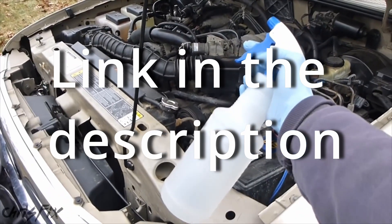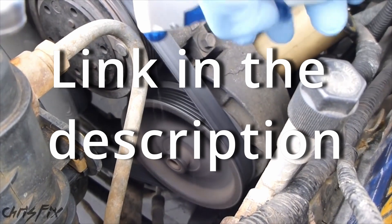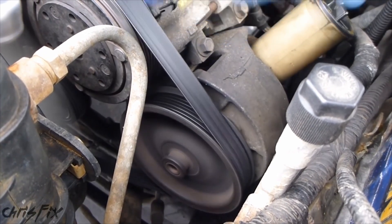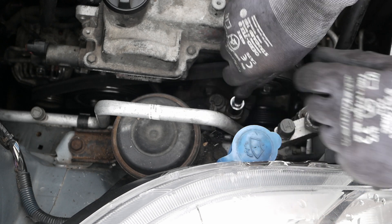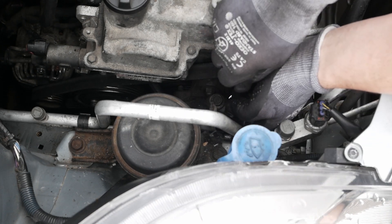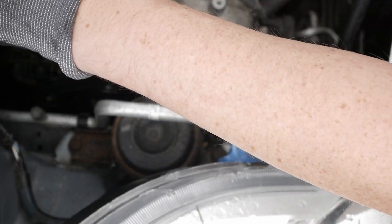His video said to spray water on the belt, and it stopped squeaking — it's probably time for a new belt, caused by misalignment and worn-down belt teeth. I thought I'd replace the idler pulley first because it's a quicker and easier job, and only a couple more quid. That other one probably needed it anyway. But I replaced it and that wasn't the fix — it still squeaked. So we've got to take off the engine mount and change the belt.